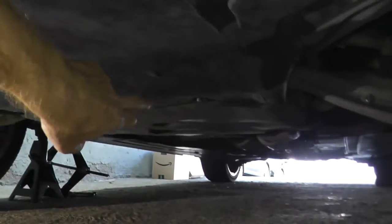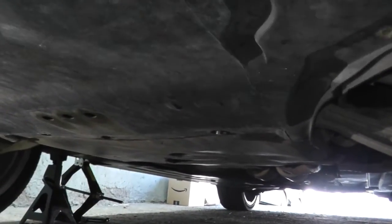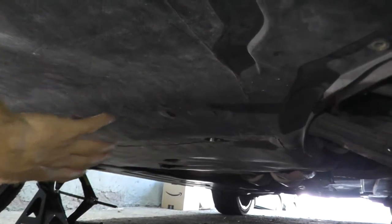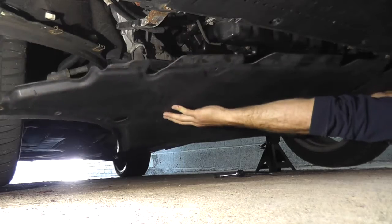For example, toward the rear of the tray there are different types of fasteners — one is missing, and another is completely different. Some are captive, meaning when you loosen them they stay with the belly pan. Over the years people don't know this, and now these really need to be replaced. This slides out and drops.